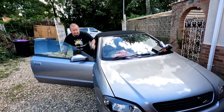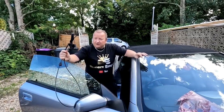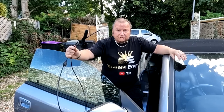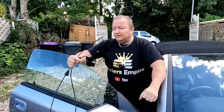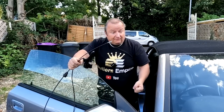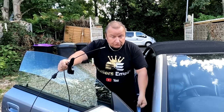So, this brand new cable, which I bought off of eBay, it's not for a right-hand drive car. It's for a left-hand drive car, which I obviously didn't know because I ordered it off of a UK site. So God knows how that's happened. And there was no parts I could use on it because the handle's round the other way. And I proved what the problem was by basically, once I did eventually get the bonnet up by pulling that handle, lifting it up, and then coming to operate the cable again, the cable was nice and free.